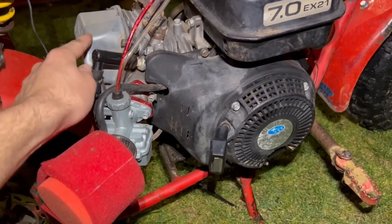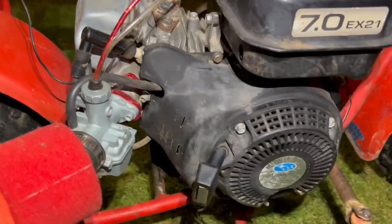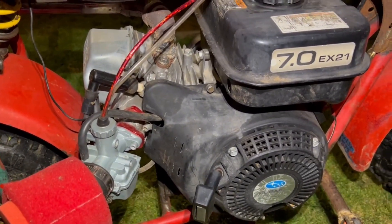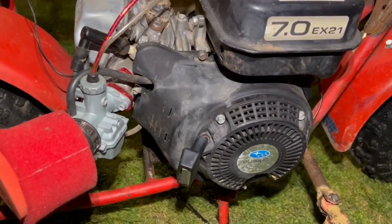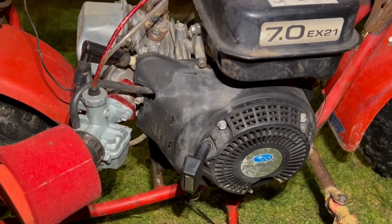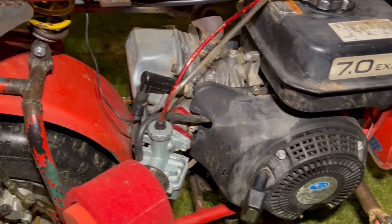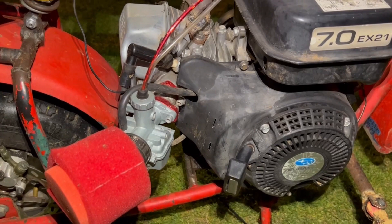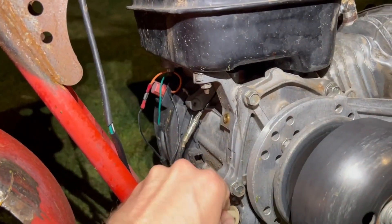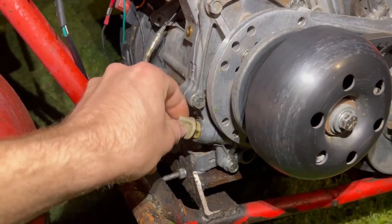When I switched the heads I also deleted the governor — no governor arm in there. I put 22-pound valve springs out of a Predator in it. I did this Mikuni carb — it's a Chinese knockoff from Amazon. I did a lot of research for this motor build. A lot of jet boat guys do it because these motors run super smooth and have a lot of horsepower with that overhead cam. I got it all taken apart and looked at the top end and bottom end and couldn't find any signs of where the metal shavings are coming from. Everything is clean in there. I had to clearance the block to fit the billet rod that's in it.